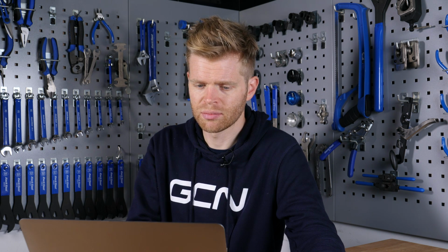Although pedals for one-piece cranks back in the day did have a 1/2 inch by 20 threads per inch thread, if we're getting really nerdy and geeky about this. And then older French bicycles used to have 14 by 1.25 millimeter threads, but these are pretty rare. Thankfully, you don't see many of those, but there you go. Anyhow, you asked, so I answered.